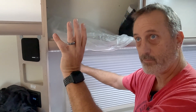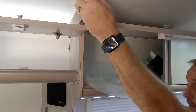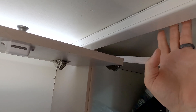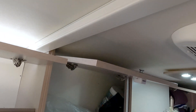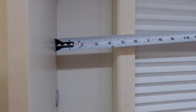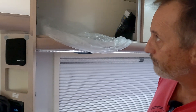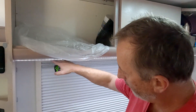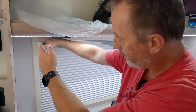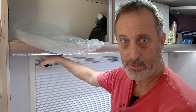There's other stuff on the roof like solar panels, and there's a metal bar that separates the over-cab from the rest of the camper, so I need to avoid these points. The reference point I'm going to use is the window. I can tell right now that I have about five to six inches to avoid, so when I get on the roof I'll look over the edge to align myself and know I can go forward to the window about five inches.